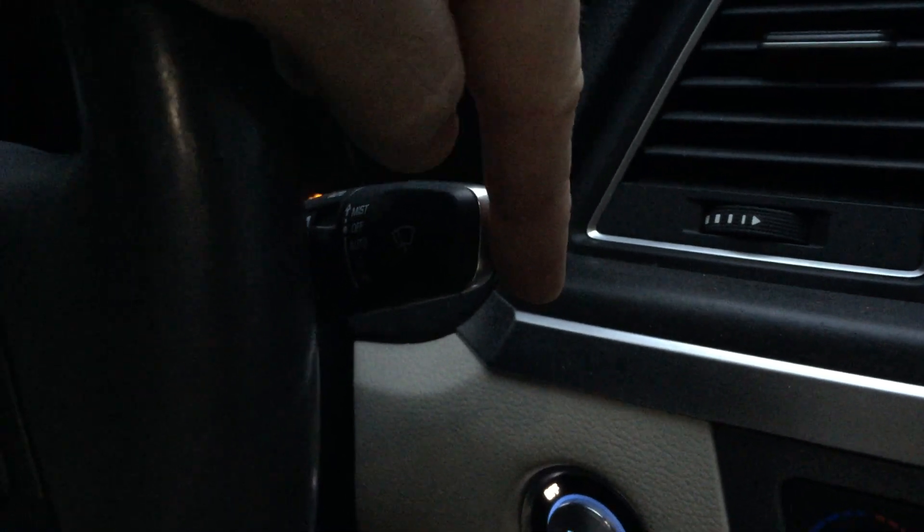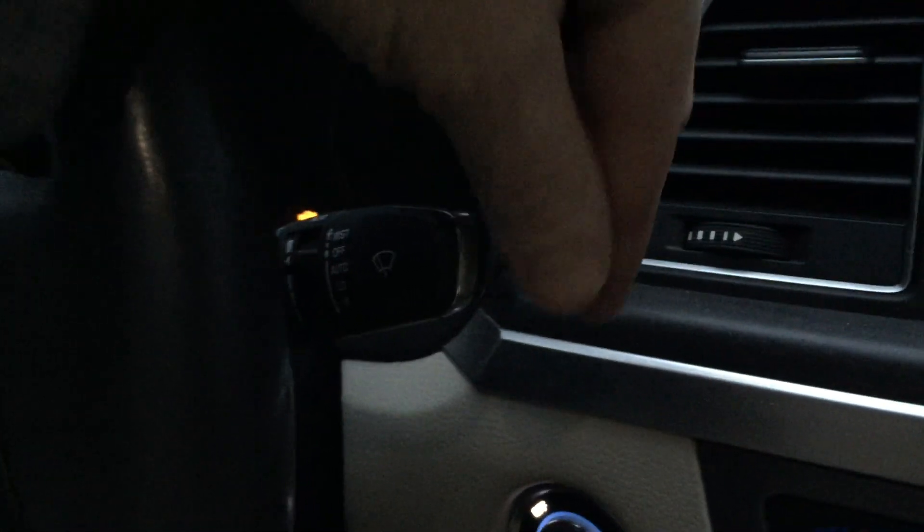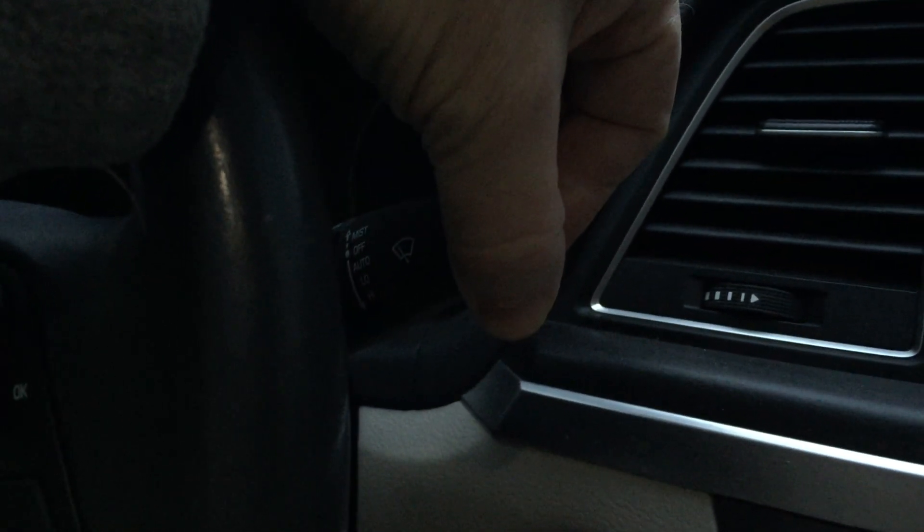You simply want to come over here to your wiper knob and you want to raise it up. The manual says 20 seconds but I find it's a lot shorter than that, so I'm going to raise it up and hold it. I'm holding it — there they went. The wiper blades went up into what's called the service mode and you can now change the wiper blades.